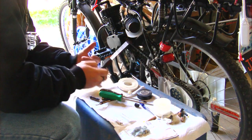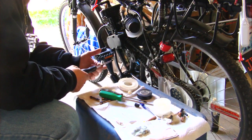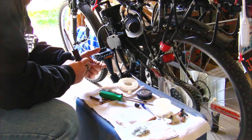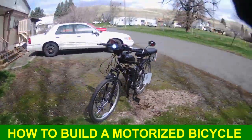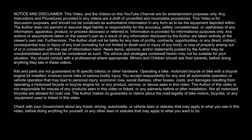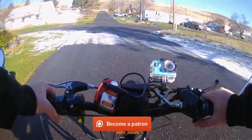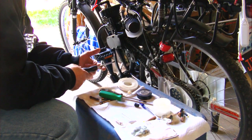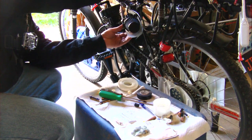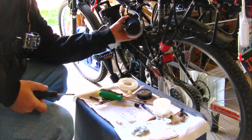And so, since before, we've got 0.64 millimeter in there now. We've tried 0.62, and we got 2 miles per hour faster. So I'm going to go clear down to a 0.60. And if a 0.60 does not work right, doesn't get us up to good enough speed, then I think it's obvious that we may need to go smaller.